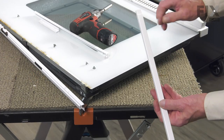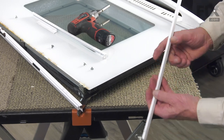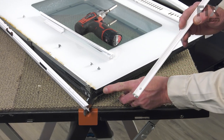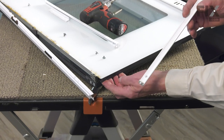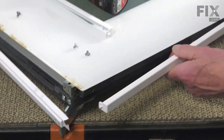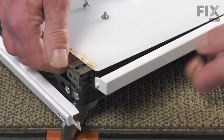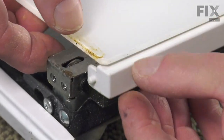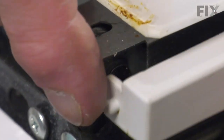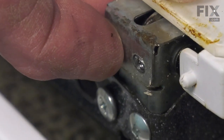Now when installing the new trim, we want to put the beveled end in first and then we'll tuck that up tight against the inner door panel. We'll also want to make sure that this little locating pin fits into the hole on the bottom edge of that inner door panel. Tuck the beveled end in behind the top vent, lift up on the glass, just pull that down enough that the bottom will clear that inner door panel, and then line it up so that the locating pin goes through that hole, and press it flush.